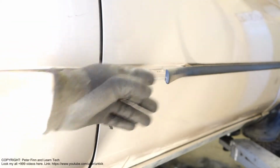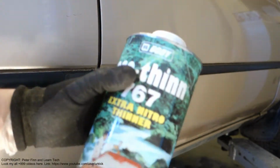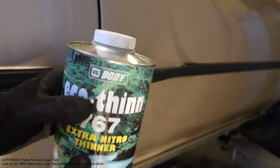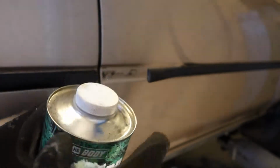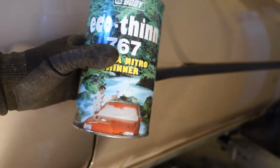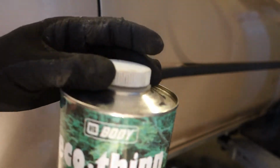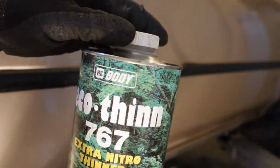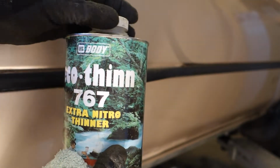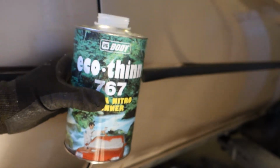In all areas, after the metal brush cleaning, we then need a special cleaning thing. It's called thinner. This is car painting thinner, and it is an extremely good cleaner, but it is also very dangerous to us. Always work outside and open the gap, because this thinner liquid damages our brain and breathing system. It is like something like a small cyanide, and it is very dangerous, and keep it away from children.